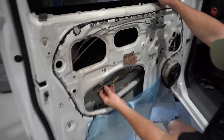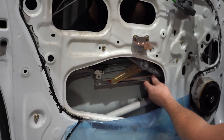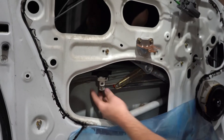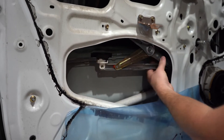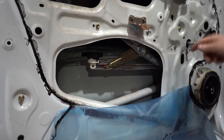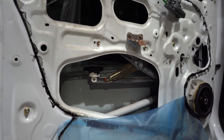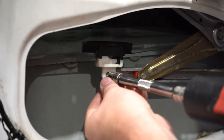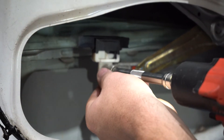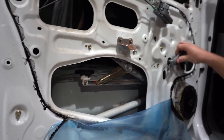So now the door glass comes right down to where your window regulator is. Bring your little bar across, and do this end first — dropping it in past that, behind it — see how it pops in like that. Get the other end in as well. At this point the window regulator would actually take the glass up and down, but to finish it off we'll put our 10mm bolts in — not too tight. One click, just like so. Bring the window regulator up a bit to access that other bolt through this hole.